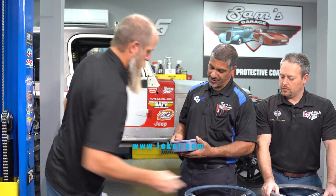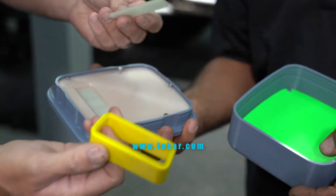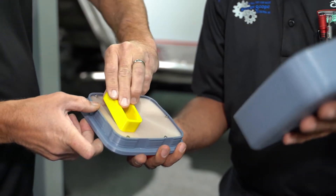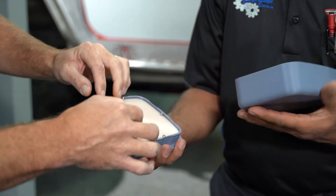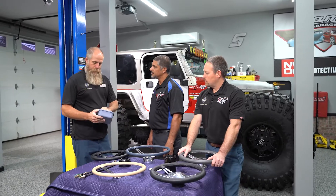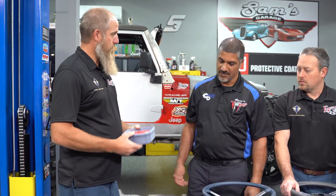What about this? This looks like a Jeep tail light — is this something you made for your Jeep? It is. This is actually in prototype phase, so this is all 3D printed. This is a normal process for us — we'll do all the CAD from our idea. We're taking an incandescent bulb tail light and putting in a modern LED. This has got all kinds of nice diffusing so that you don't see the LEDs, and it's going to be much brighter and a nicer unit.